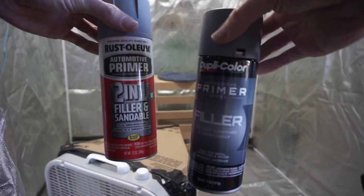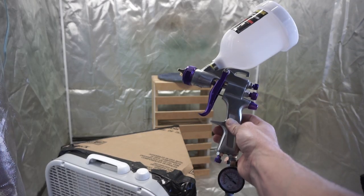After sanding 120 grit, it was time for filler primer, and if you've watched any of my videos, you know I say do whatever filler primer you like, whether it be Rust-Oleum, Duplicolor. This time I used a completely different one, but whatever filler primer is available to you and the cheapest, go for that. I tried to learn a new skill set in this one. I bought an HVLP setup, one of those automotive spray guns, and I sprayed a 4-to-1 high build primer. I do think that kind of primer was overkill for this. You definitely can do the rattle cans and it'd be easier. Having to clean the gun and then also doing a bunch of mixtures of 4-to-1 and like 5-ounce increments over an entire suit took so long to do. Rattle cans would be very easy.